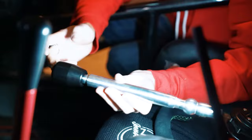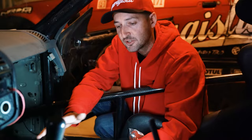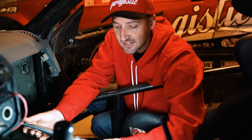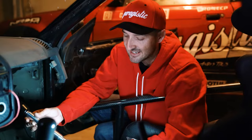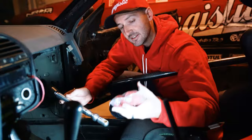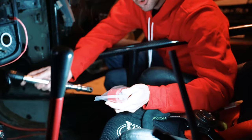This chassis-mount shifter was custom anodized red, but they have them in black, silver, and over 400 configuration options. It's all modular — you can unscrew the top and run different heads on it, and really custom design it to your feel, style, and driving. They have taller extended versions or short factory-style ones. This is an amazing upgrade — it lets you feel what gear the car's in and find your way around the track without guessing. It saves you time if you're racing, and saves blown motors if you're drifting. Also, don't forget the transmission mount bushings — replace those while you're in there, and match them to the motor mount. If they're red go red; if they're blue run 95 rear and 95 front. You don't want the transmission twisting on you.